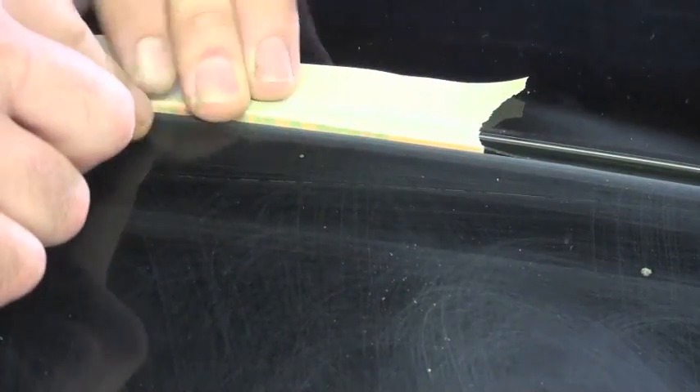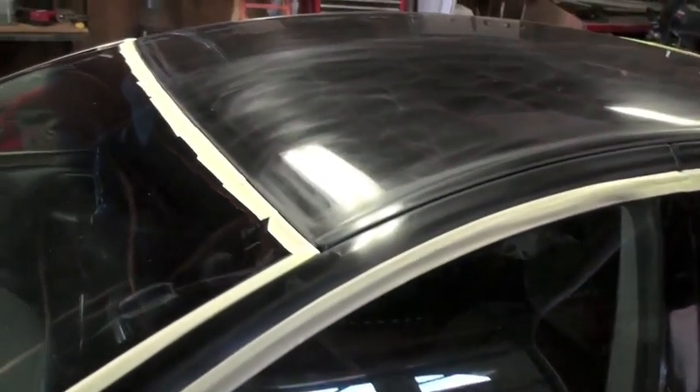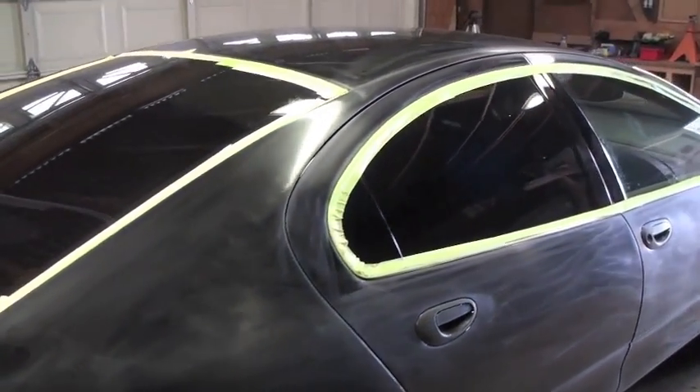When you're done painting, your moldings and stuff don't get overspray on them. Repeat this all around the windshield and the rear window. The masking around the windows we're going to keep and just leave that on after we're done sanding; the ones on the sides I'll retape.